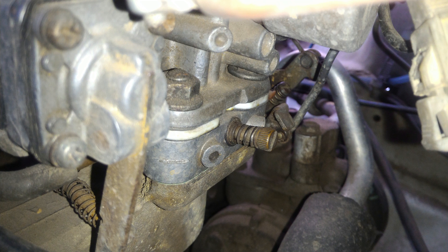Now that we've set the spark timing, it's time to go on a short ride to warm up the engine completely. When the engine is running hot, come back and find the screw behind the carburetor. Opening it counterclockwise increases petrol flow rate; closing it clockwise decreases it. Completely close it, then open it four rotations. As you start rotating, you'll feel the engine RPM changing. When the RPM is at maximum, that's where the right petrol-air mixture is — there will be a flat spot there. Open it further and the RPM goes down, so there's only one optimum point. Set that and you're good to go.